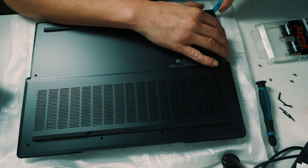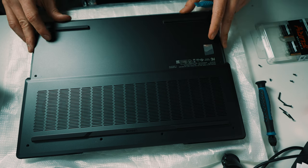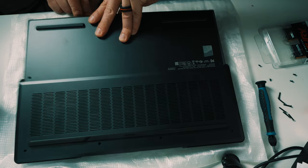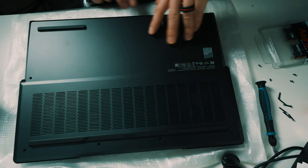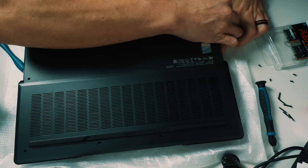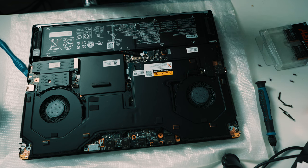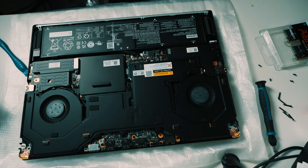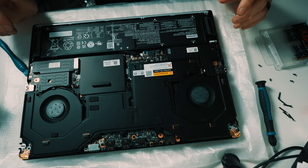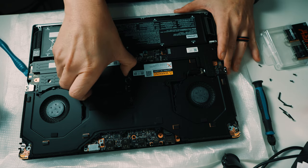I'm just working around and trying to find a little crack to get it open. Eventually you pop it off — just use a little bit of force and tugging and it'll pop off. These laptops are a lot sturdier than you think, so using a little force, you don't have to worry about it breaking. Looking inside, you'll see the memory is covered — I think this is for thermal heat-sinking purposes.